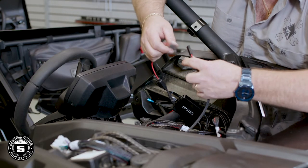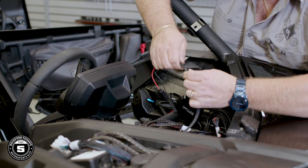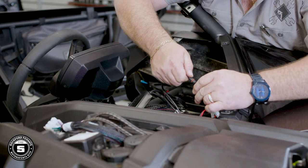You're ready to install the new Rockford Fosgate Color Optics controller. This is a Bluetooth device that will allow you to remotely access the lighting features through the RF Connect app. Start by connecting the power cable to the PMX harness and then attach the waterproof connections to your speaker cables.